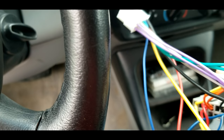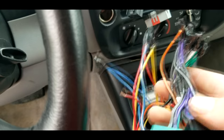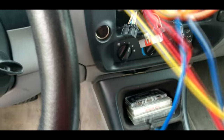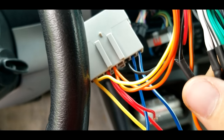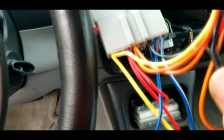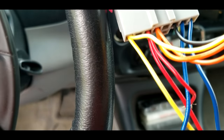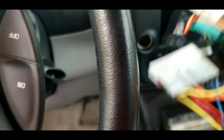Now, in this particular radio the harness did not have a blue wire that addresses our issue. There's a blue wire that comes off your car, which is part of this extra harness. As you can see, you've got two blue wires here — one with a white line through it and one that's just plain blue. You'd think the white line means ground and blue is for a speaker, but no — each of those blue wires is something completely different. The solid blue one is for what's known as a power antenna — that's not your issue with the sound, so you can ignore that wire unless you have a power antenna.